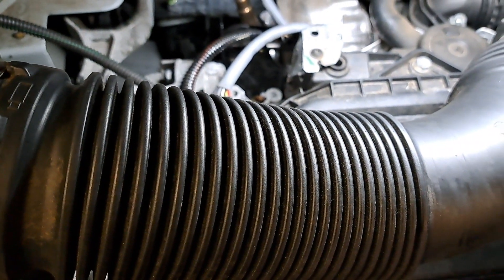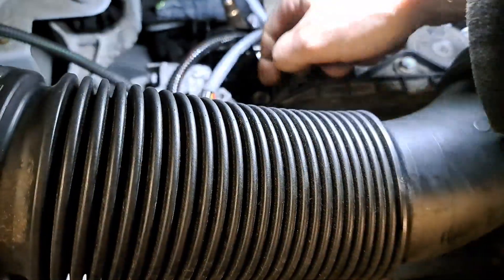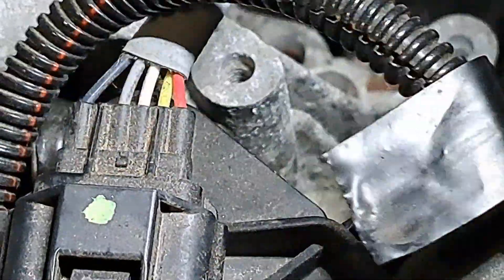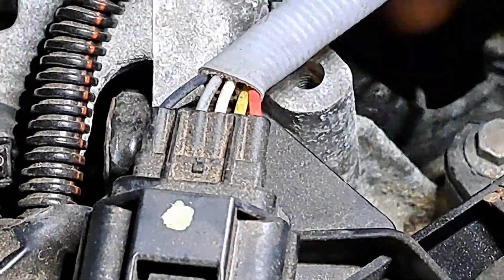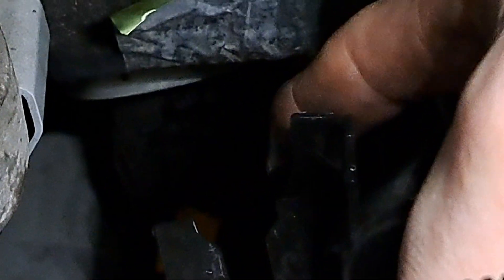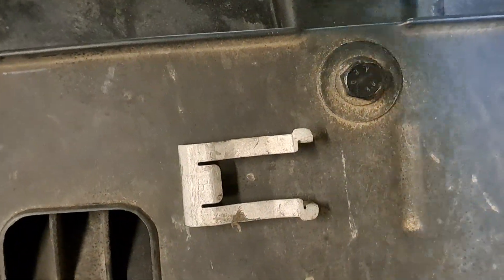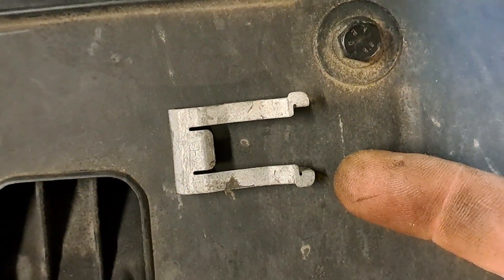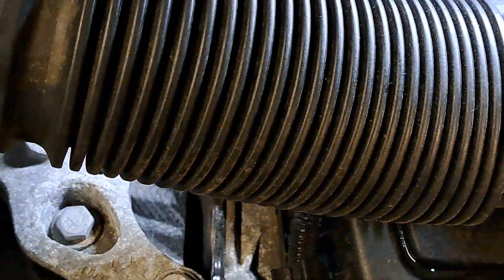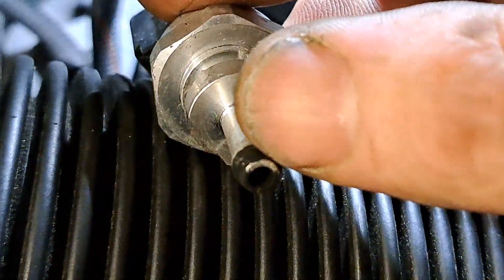The clip you can't get to is a little bit frustrating. The actual sensor itself is held on to this bracket here. That pipe links to this pipe here and this little tab goes underneath. I found the easiest way to get this off was to put my fingers on this side and just push these out either side and wiggle it out. I took the sensor off because I've seen some people that have had problems with the end of this sensor melting.